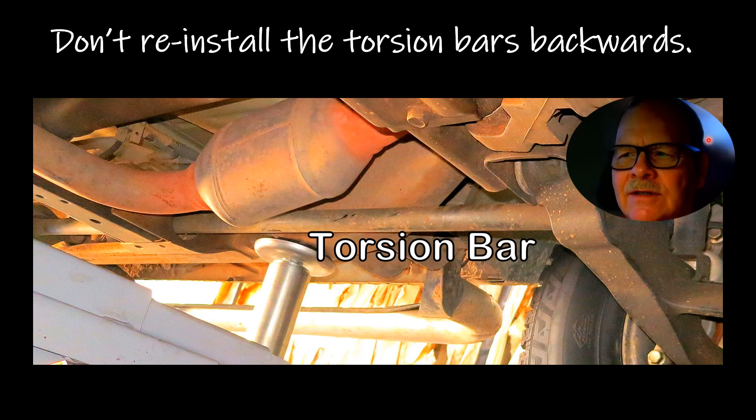It's got a thing sort of like a wrench that's adjusted with a jack screw, so you can actually adjust the twist pressure on this spring. The reason they have this is because these four-wheel drive vehicles have got an axle going out where the spring is supposed to go, so the torsion bar provides suspension springing. This one goes all the way back there.